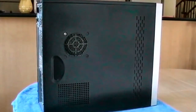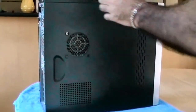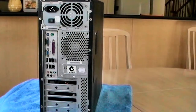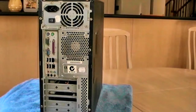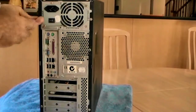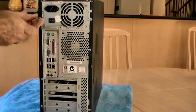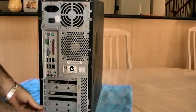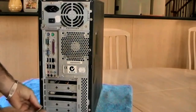To fit a wireless network card we need to disconnect the computer from power sources and other cables. Good idea to put it on a table or a workbench at a convenient height so it's easy to work on. First off we need to remove the panels. In this clip you will see that I'm removing both side panels of the case, but there is only need to remove one — the right hand side panel when you're looking from the rear of the computer.